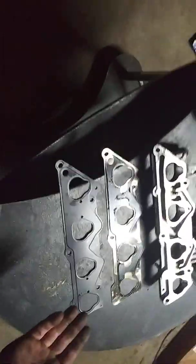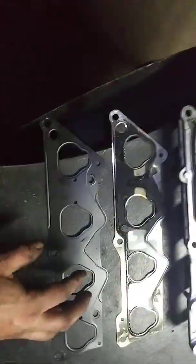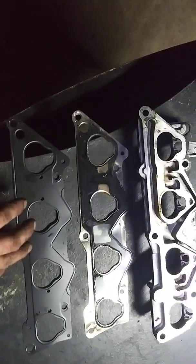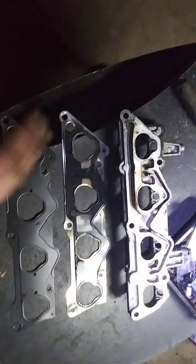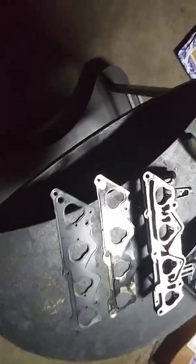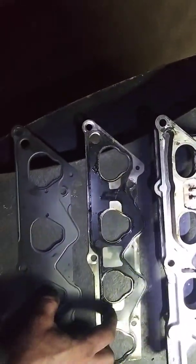So then I was thinking, oh man, might be that gasket. And I saw that some other people had similar problems also. So if you ever got that P0401 EGR flow insufficient code on a Honda Civic between the years like 2003, I think it goes up to about 2006 — make sure you check the intake gasket.